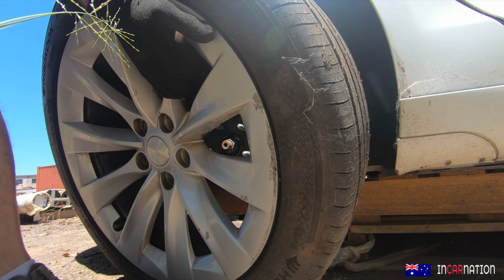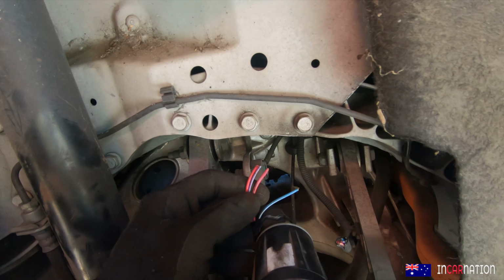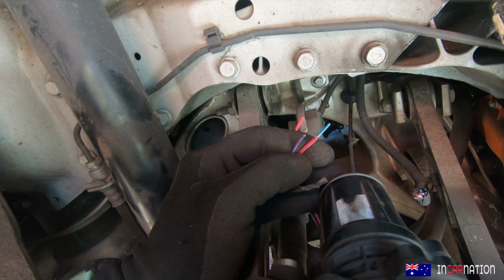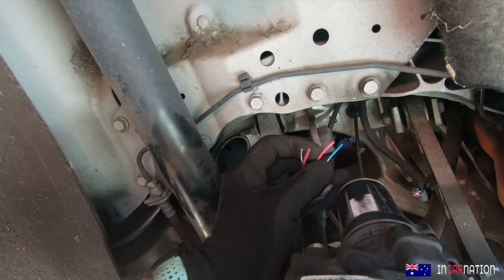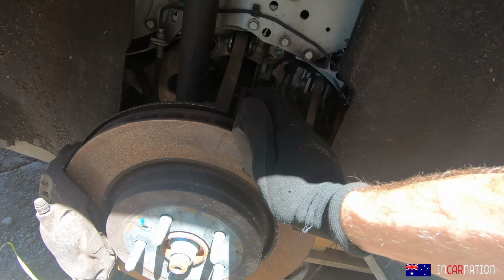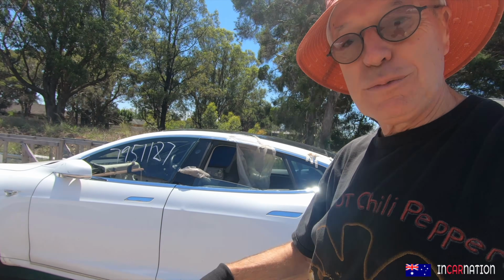Alright. I mean, look at the size of these Tesla brakes. That's fantastic. So they're the main brakes, and this is the parking brake. So what do we got? 4 leads. Okay, 2 big ones. They'll be the power. Hopefully that's power and reverse polarity, so it'll run backwards to unlock if you turn it one way, and the other 2 I think are a Hall effect sensor to detect whether it's actually engaged or not. So we only need 2 wires for ours, but we'll see. So let's get that off and see if we can make it fit to the Porsche. So then the Porsche will be not just MG bits and Astra bits, it'll be Tesla bits as well, bit of everything.